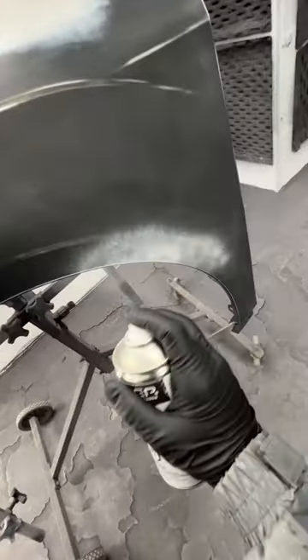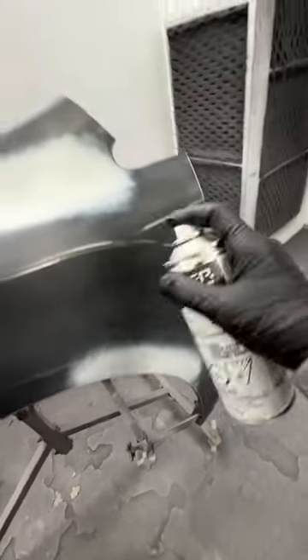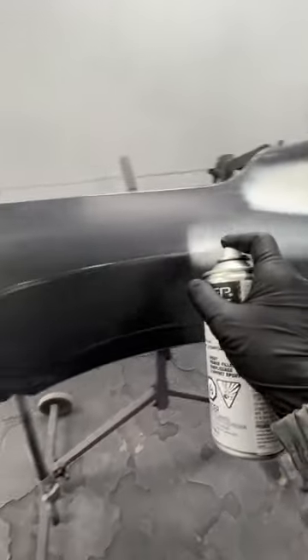I love using this Carrep 2K epoxy. Anytime I have a burn through on this e-coat, I always splash it with this. Treat it like any other epoxy, let it sit about 30 minutes, and you can seal on top.